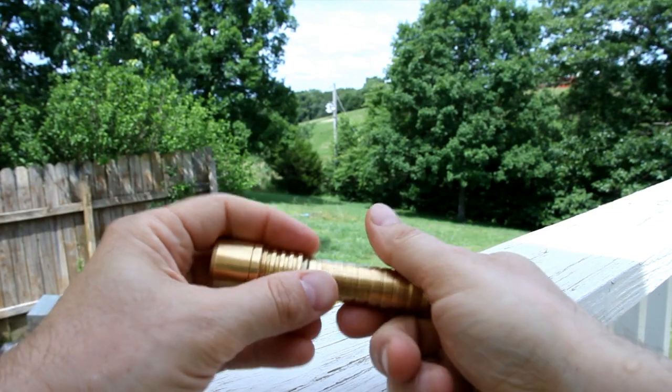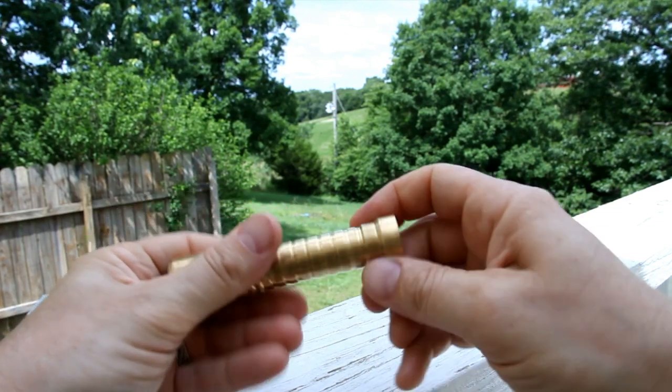I just think it's the most dependable way to do it and that's why I wanted to do that. It also gives the light a better lockout. There's plenty of room here to open this up and still have coverage over the o-ring, and the other way would do that at the length it was at if I cut the tail spring, but this way we get to keep the whole length and strength of the tail spring and also have a reliable lockout without adding any length to the light.